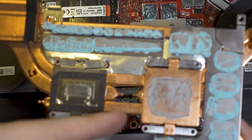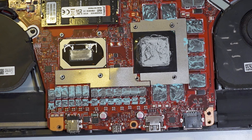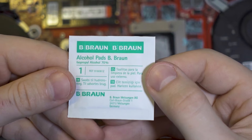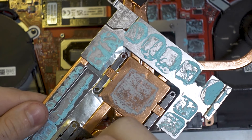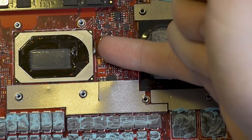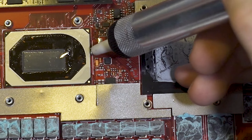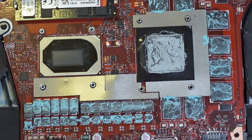I don't know why they didn't go with copper directly, but I'm gonna start from the CPU to understand how liquid metal works since I've never done it, and then maybe put it on the GPU as well. I got some Conductonaut here from Thermal Grizzly - I guess this is the best one to use. I'm gonna use the alcohol pad they give you and clean everything up. Oh my god, it's like mercury. Be careful - some of it has gone outside, which is a big issue. I'm going to use a solder removal pen to suck it out. It's shiny clean now.